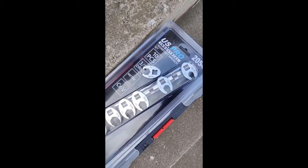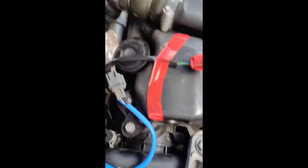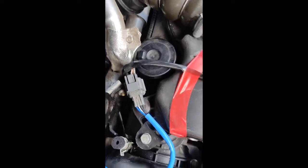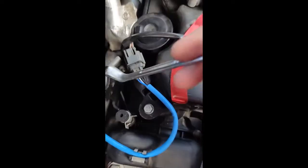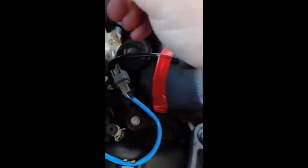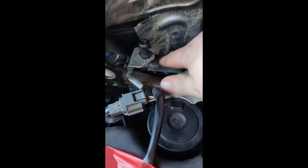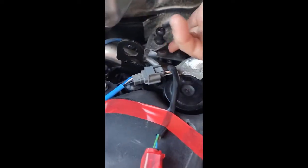I've got some nice crow's feet spanners from Amazon but I'm still struggling to get in around the pipe down there. I saw a video where a guy managed to bash back the cover a little bit, which lets you actually see it. In order to get more access, I'm going to take off this little bracket that was holding the sensor. That's an 8mm spanner to get that off, and then I'll take the other nut off — that's a 13mm and I'll put a socket on it from the top. That'll get this bracket out of the way and give me clear access down there.